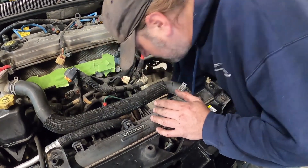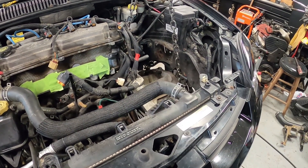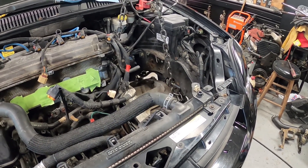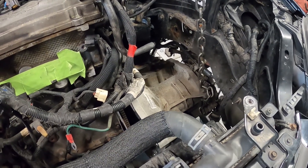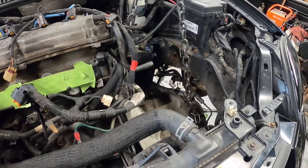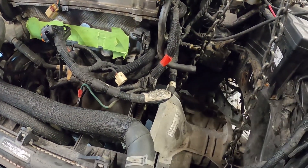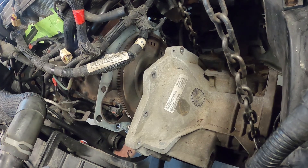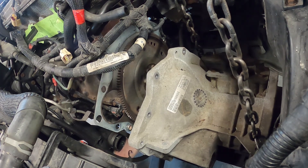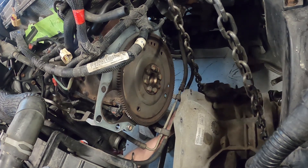When doing this you've got to watch out for your power steering lines. We're going to lower this thing slowly. Watch out for the lines - there's the power steering lines toward the back, the speedo line. I've got it underneath. Do not be underneath it while lowering. Good - push it out of the way. We're setting it on the ground.